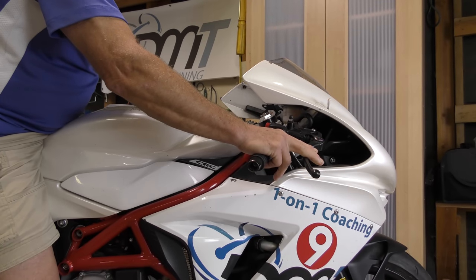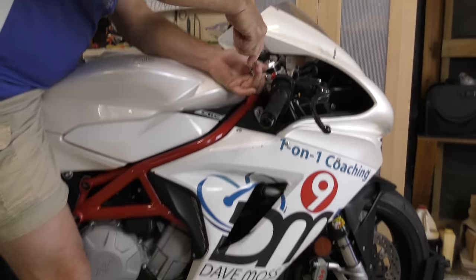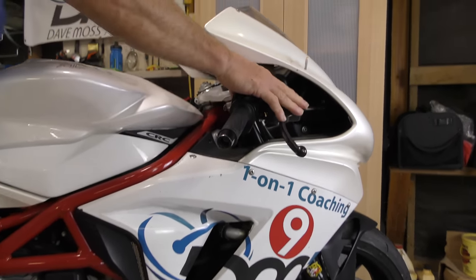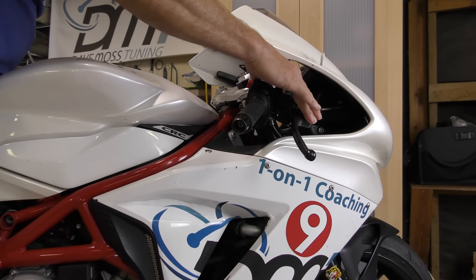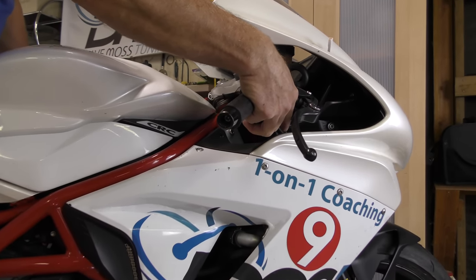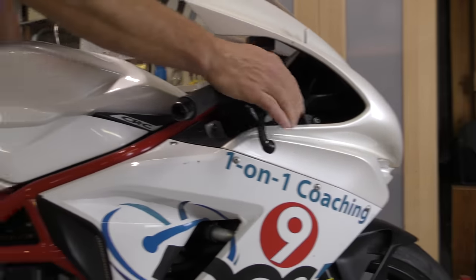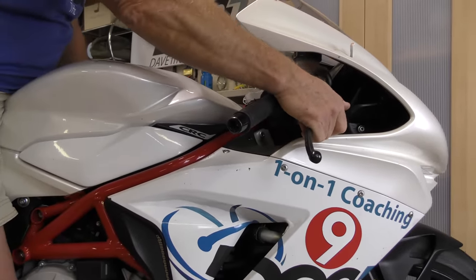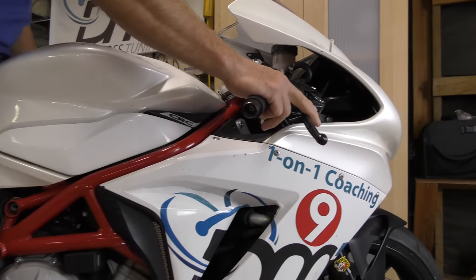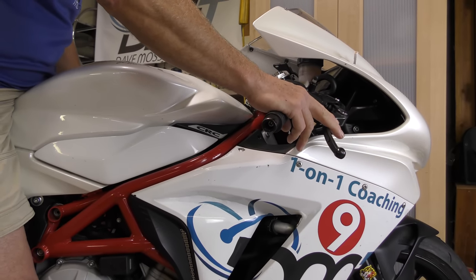That's incorrect. So step two: let's see what movement we have for the position or angle that we need. How far can we push it down? Sometimes the brake line will hit the fork, so that will be your maximum limit. Other times cables can come under here and be your limit. So don't force this down — get it to where it naturally stops. From here, I don't have to accelerate into a braking situation, so that angle works fine for me.